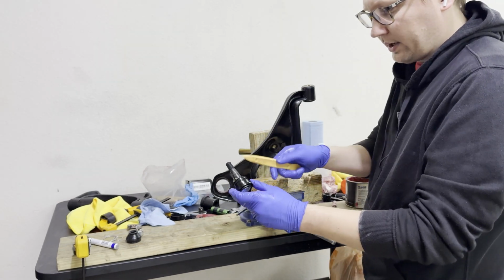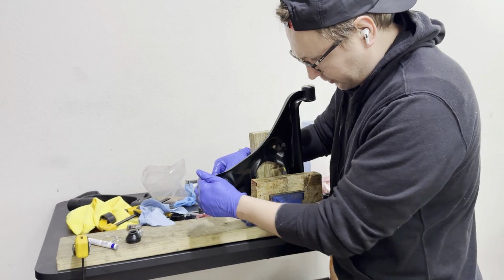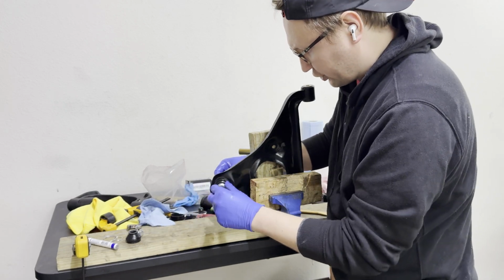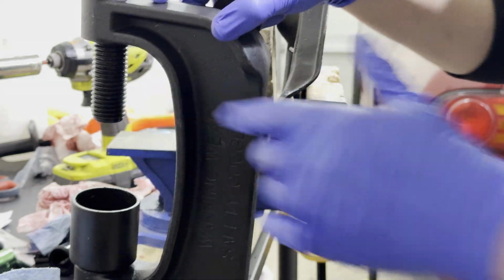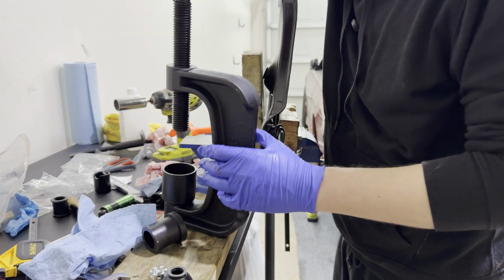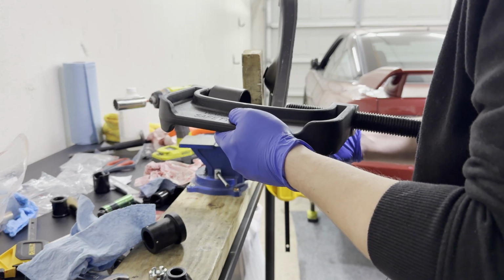So now that we have the shank and the ball joint exposed, we can easily insert it into the receiving end without it snagging on any of the stuff, like crunching it. We're going to use this Johnny here to go ahead and pretty much press this thing in here. And it will be up front. It takes so much effort to actually get it pressed in.